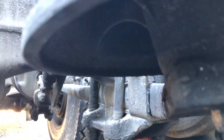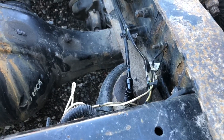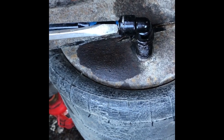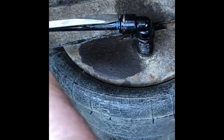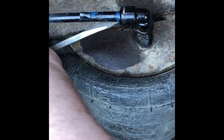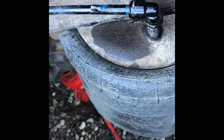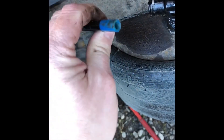That one right there — if you can see it — is a three-quarter also. So there's actually not much holding this in here; you just gotta be a little bit smart to get it out. Basically on the airline you see this little lip right here — you don't want to break it because it's plastic, but all you're going to do is just go around it and push it in. As you see it's moving, and what you're doing is any dirt or debris in there will kind of work it free. That's also why you want to have the WD-40 on here. You just keep working your way around it, and then while holding that down with your fingers, you've got the airline off.